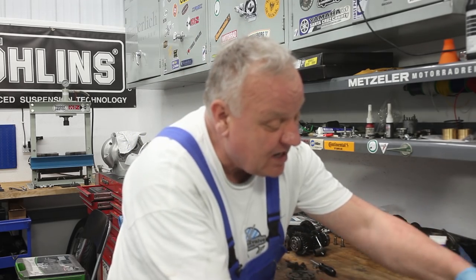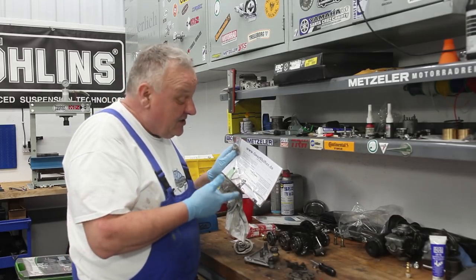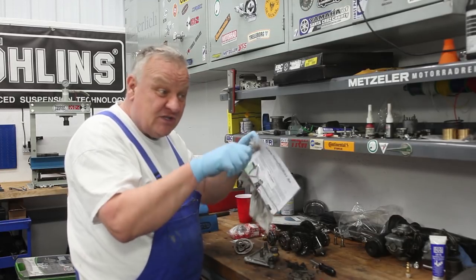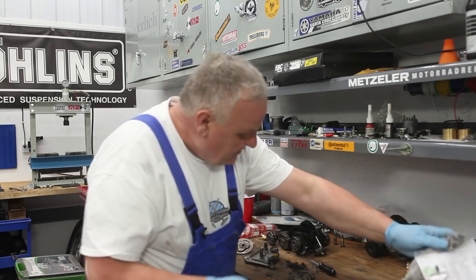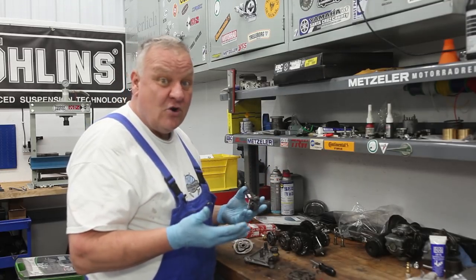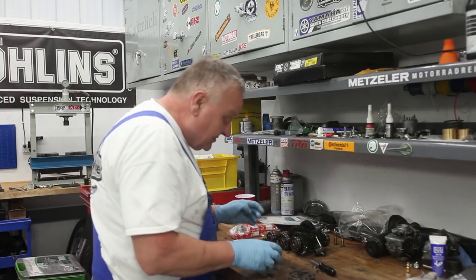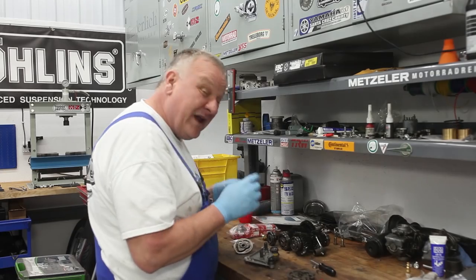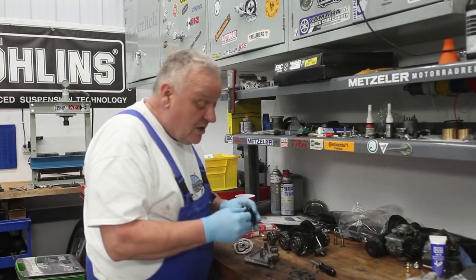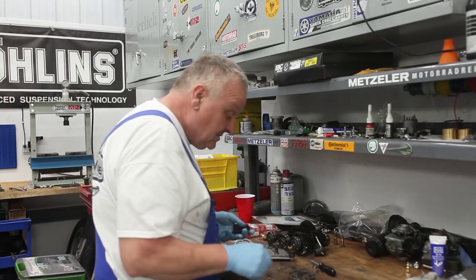We have a video about this and offer a gear shifter tool. If that spring breaks, you can take the filler plug out of the gearbox, insert the tool following the included instructions, and mechanically move that piece up to shift into a usable gear so you can make it home to a safe place. Check that out on our website. Whenever I have a gearbox apart I change that spring anyway — it has a certain lifespan and we don't know where it's at.